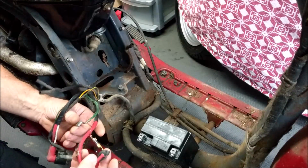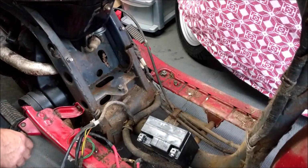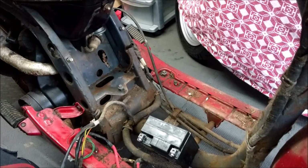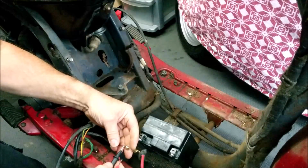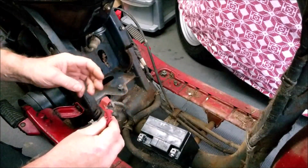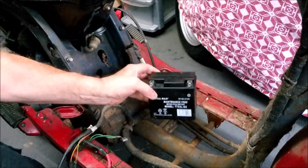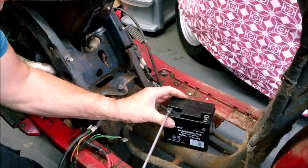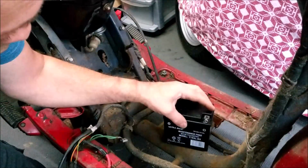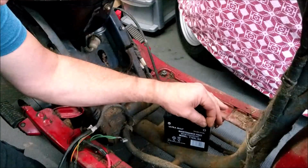Righty all, well, here we have what's left of the fuse holder. I suppose I better bell that through, hadn't I? Where's my majestic tester? Here's me little Martindale. Continuity. Right, we have continuity, so that's good. We have the earth, or the negative, and here we have the positive. So let's just get straight into it, shall we? And whiz these off. I have tested this. It's running at 12.74 volts, so that's good, as it's been sat there for quite some time.